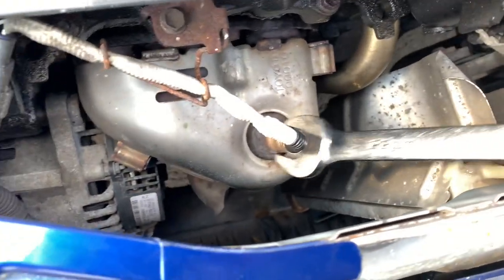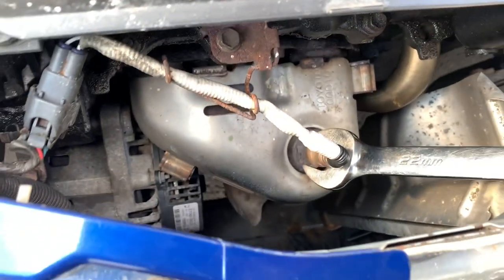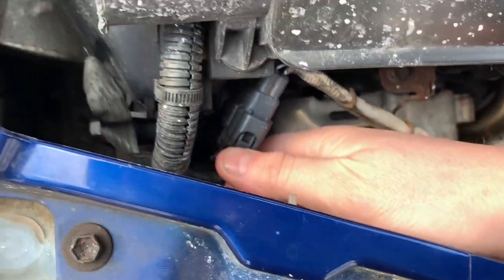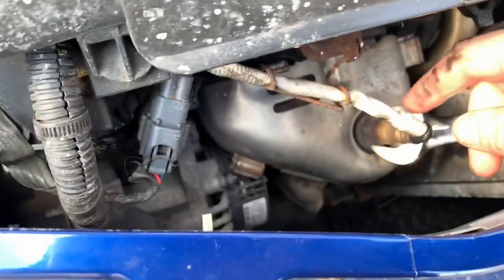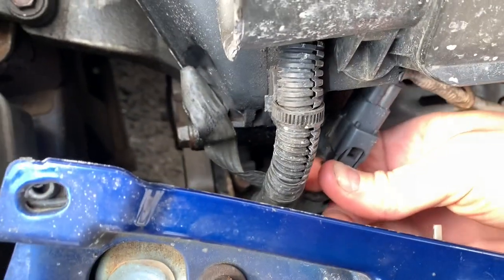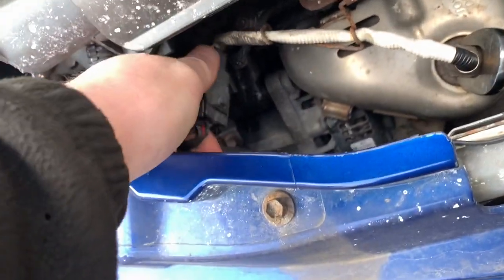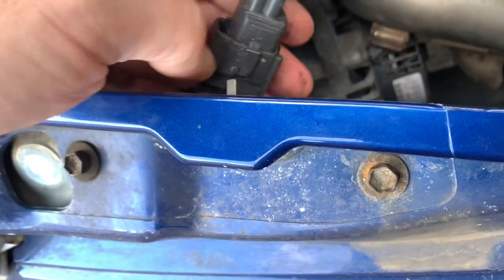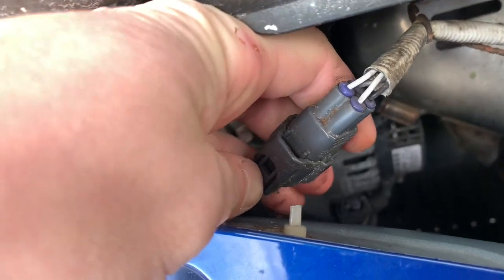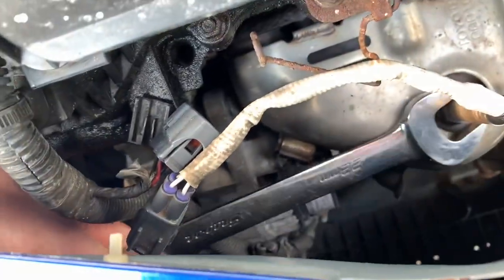Right, so it's going well. I was correct in my assumption that that's a 22mm. But I can't really get it on very well at the moment. Not really tried that hard yet. But first, let's unplug it so we can turn it around, otherwise when you're trying to undo this it just twists round and round. It's pretty awkward. Try and do it with the engine on - I've just burned. You've got to squeeze the tabs and pull it - sort of a two-hand job. Like that. So now try and get this in and get this lambda out.